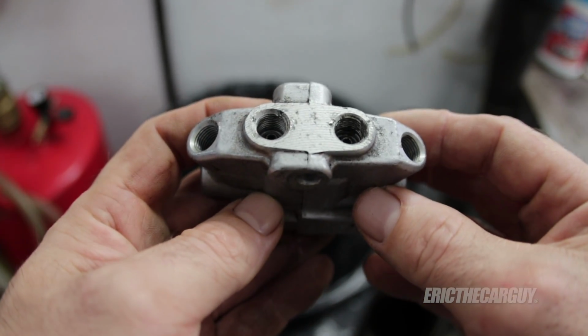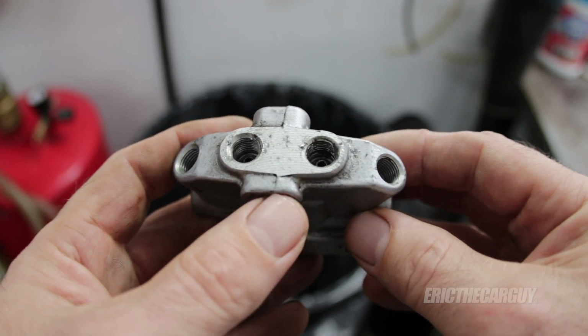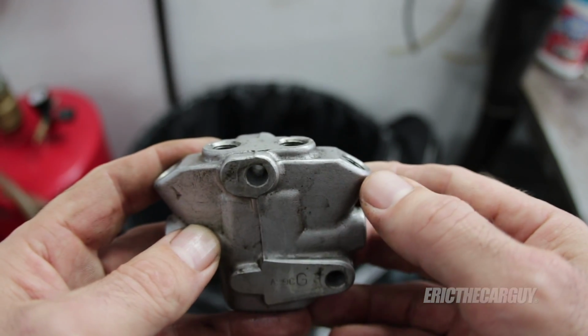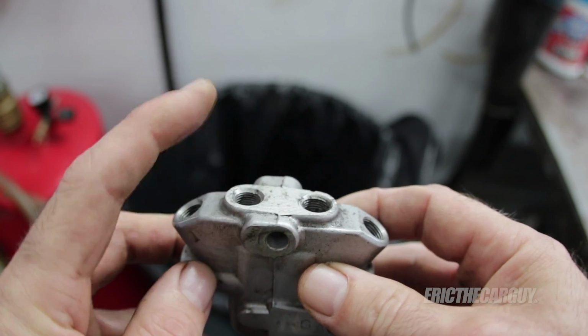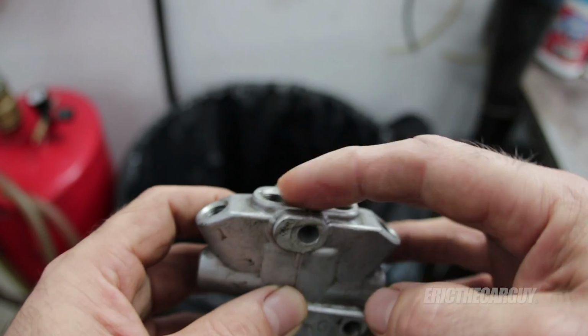This vehicle does not have ABS, which makes the explanation a little bit easier. It's a split diagonal system, so I believe this would be the left front wheel and the right rear wheel, and this would be the right front wheel and the left rear wheel. So this is the one that I couldn't get any pressure to come out of.